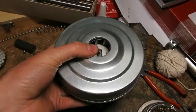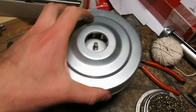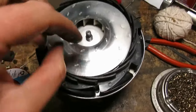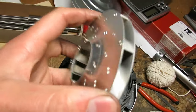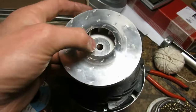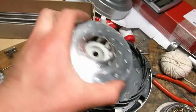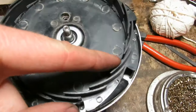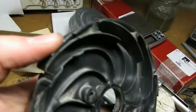Here's the actual air flow pathway, which is quite interesting. The air comes in the top through this hole — there's a tin can part — and there's a rotor attached to the motor shaft with curved vanes on it. This spins anti-clockwise, so air gets sucked in the middle, flowing out the edges, and then the air goes along these curved slots and down through these holes.